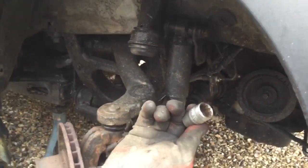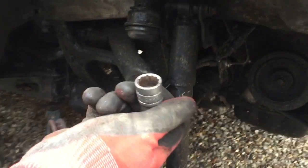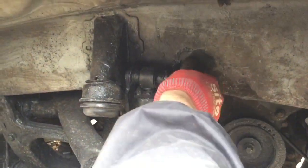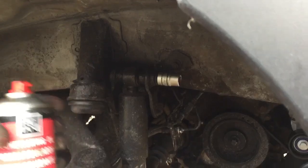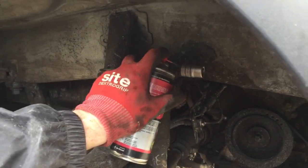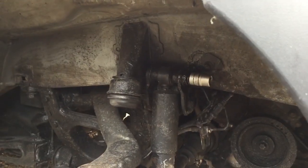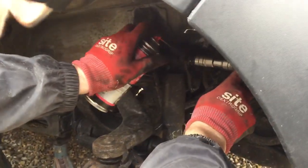Some people say you can't use these on the top - I've never had a problem with them. You'll see different sockets like a 50-pence shape in these; I always use these and I haven't had a problem to date. Before I undid these, I got some penetrating oil - this is really good stuff from Tool Station. All I kept doing was spraying in there, because I don't want to bust the bolts. Slow turn, nice and easy like that all the time - a bit more in there. It makes it easy for the bolt to come out.